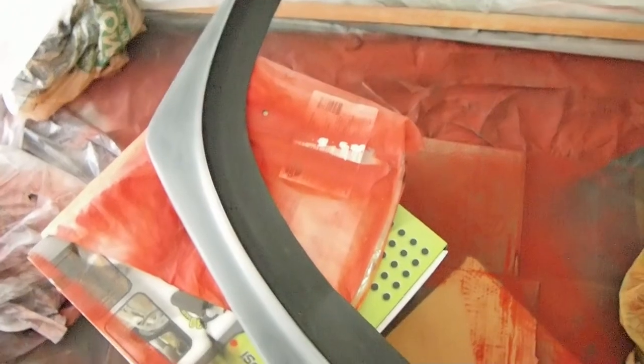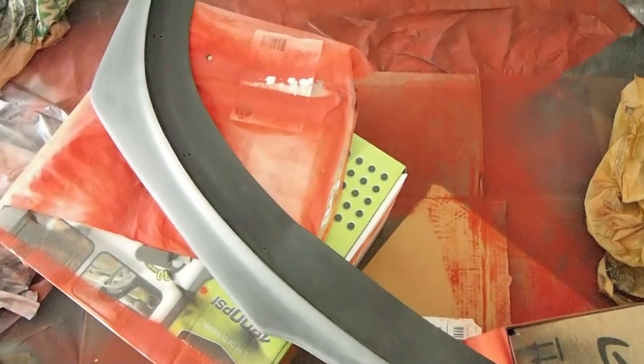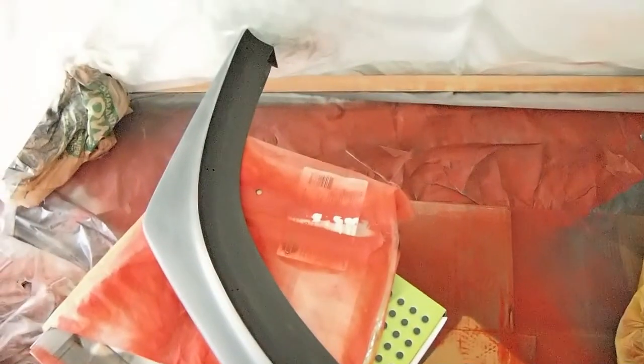So to start with, I am going to apply an adhesion promoter, since this is a plastic, and then I will apply probably 3 coats of paint and primer, and it's going to be a spray paint, and that's on the top surface. But on the bottom, I'm just going to do, well, that's what I'm going to start with.